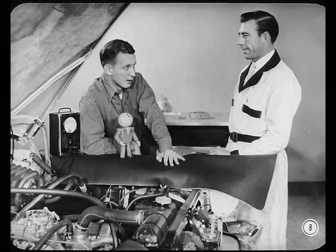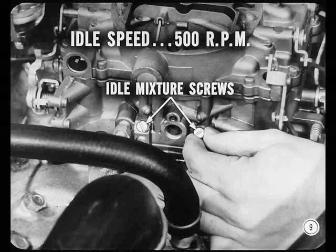Nate, did you check compression and ignition first and then run the car out on the road? Yeah, Mark. Compression, plugs, points, and timing were okay. Engine idle is still rough, however, and there's a stumble on acceleration, but just off and on, like the customer said. While the engine was warm, I set idle speed at 500 RPM. Then I tried turning in both idle mixture screws the same amount, a little at a time.